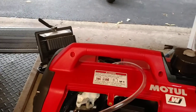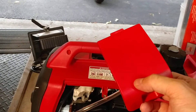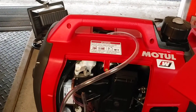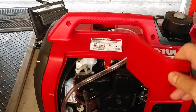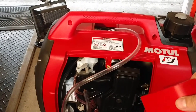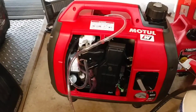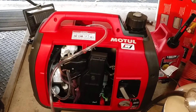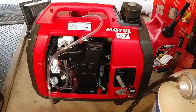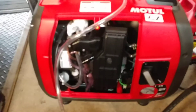I'm going to modify the access panel — drill a hole in the access panel for the spark plug — to run this hose through. You probably should use some gas line or something a little bit better, but that's what I'm using at least for testing. You do want to run the generator with all the panels on it to keep the airflow moving through the generator to keep it cool.